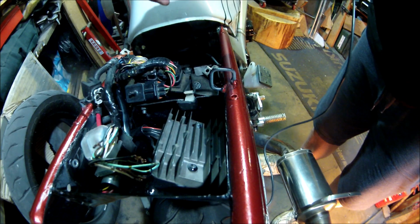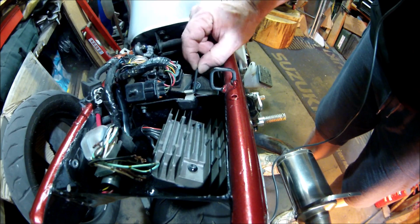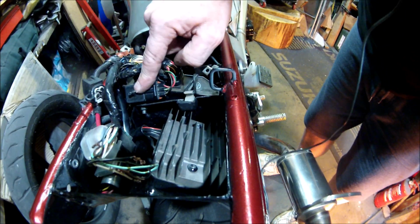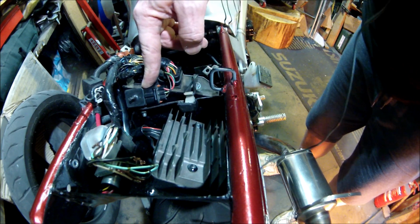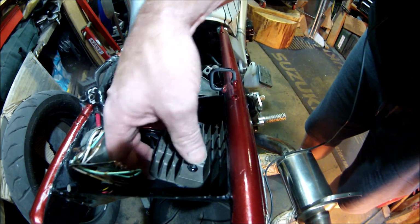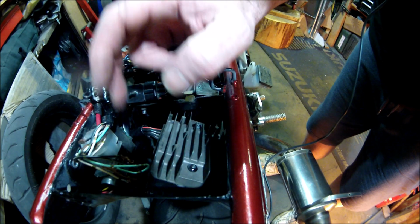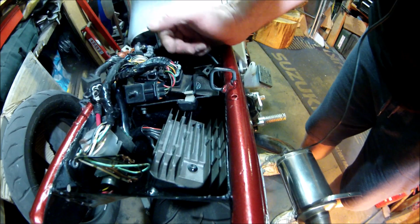Okay, ECU is elasticated rubbered in, which is the technical term for it, obviously, says it in the Haynes manual. What was that? Atmospheric pressure sensor, I think. That's bolted on. Regulator rectifier is bolted down, and that's a good 5 to 10 mil off the floor, off the bed of the tray, so that's got all round air circulation for whatever air will come in.